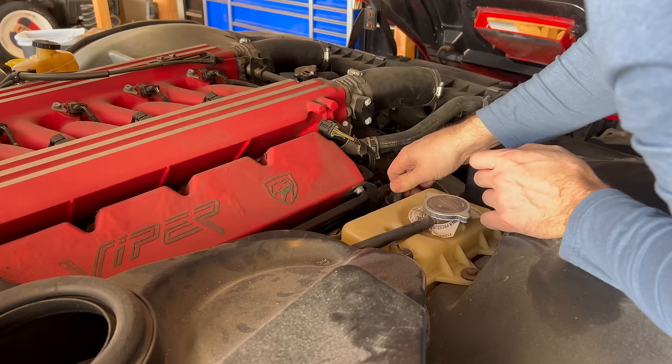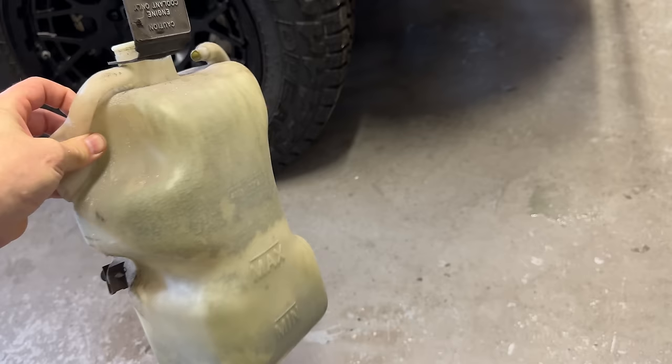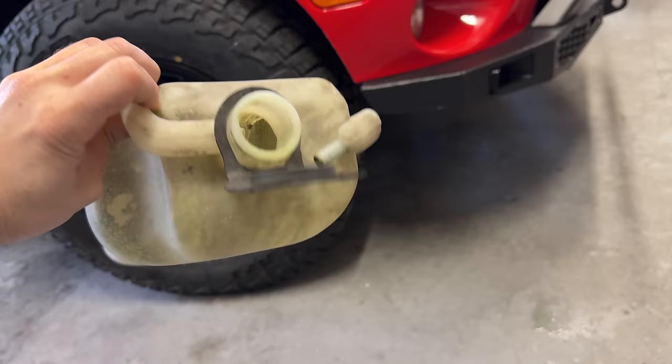While we were filling up the brake fluid, we filled all the other fluids. I had to drain the coolant to get the front cross brace out so I could finish up the front suspension. There is this coolant overflow that went behind the fascia, but we kind of modified that, so I'll need to get it back in there at some point. Whenever the engine gets too hot, it spits coolant into this bottle, and then it kind of sucks it back into the cooling loop when it cools down. I also need to clean it, but this is for another day.